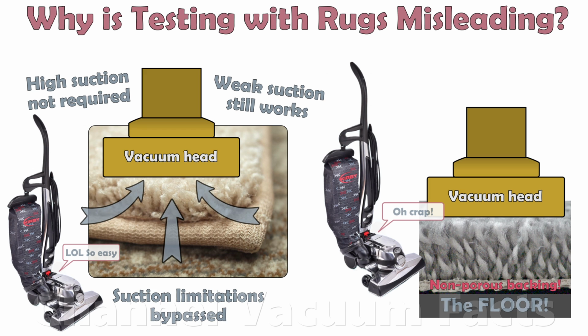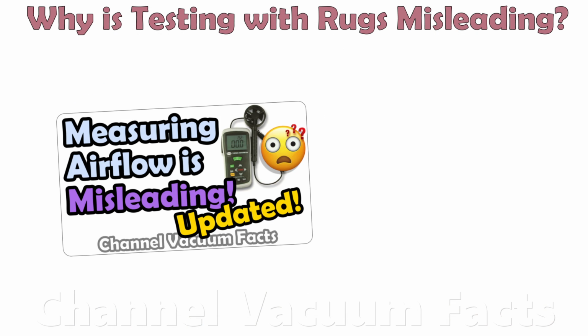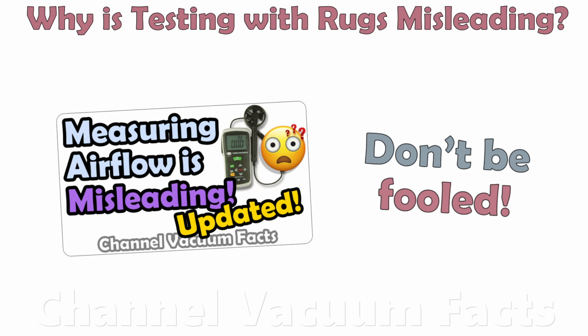And on rugs, because large airflow is coming directly from underneath, they bypass the difficulty of reduced airflow at depth. So implying that cleaning behaviour on rugs with high airflow is the same as on fitted carpets is not just deceptive, but simply wrong, as already discussed in the video with the fourth link in the description. Yet this is very commonly implied in amateur testing. Such videos either don't understand airflow behaviour through the pile, or are deliberately deceiving people to peddle a myth that low suction, high airflow machines are somehow better than the rest. Look out for it and don't be fooled.